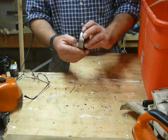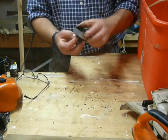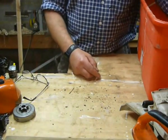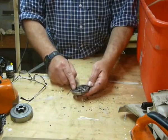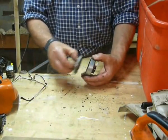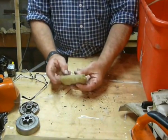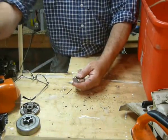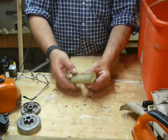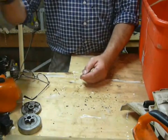Obviously it was a saw that was running quite well and oiling properly — it's a proper Stihl one. Quite a lot of buildup of muck though. Clutch — all three springs are intact, I'm assuming it's the right one. Air filter — washable one, nylon washable, and it's quite clean. You would find these all bunged up with muck, and some half-wit would have adjusted the carburettor to suit the mucky air filter. But it's clean — amazing.